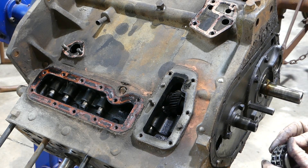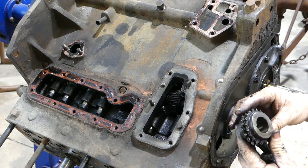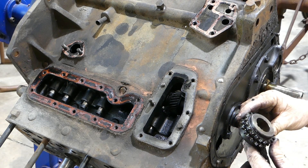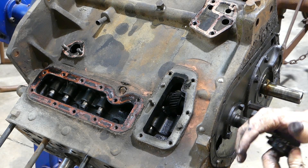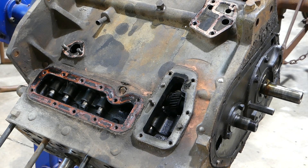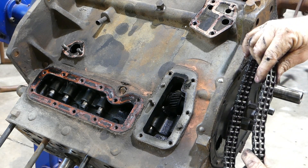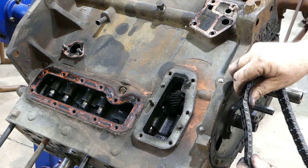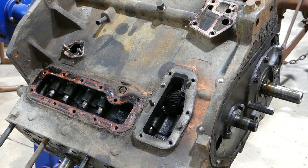There's no timing marks on there that I can see — you must just do it by piston position, which is actually a good way of doing it. There's a little bit of slop on the timing chain — readily available, well worth doing.